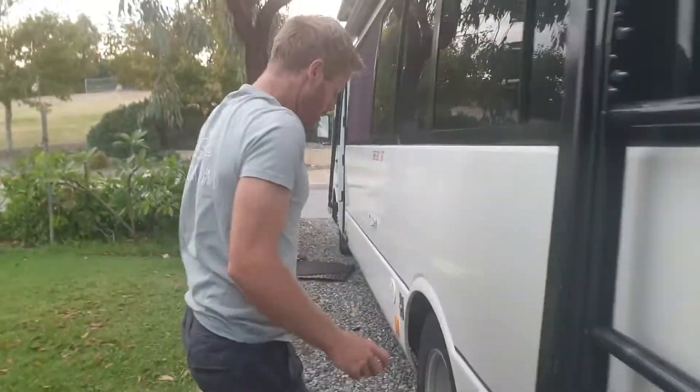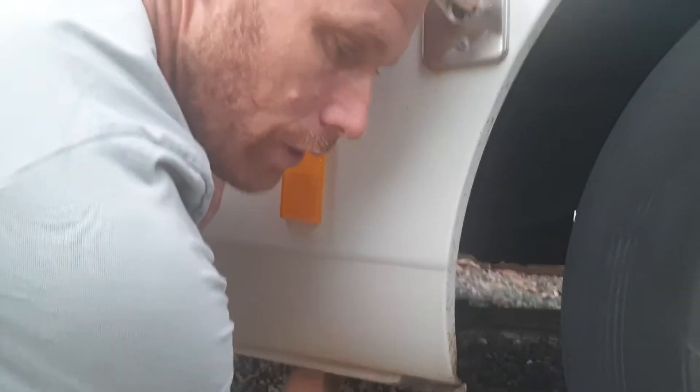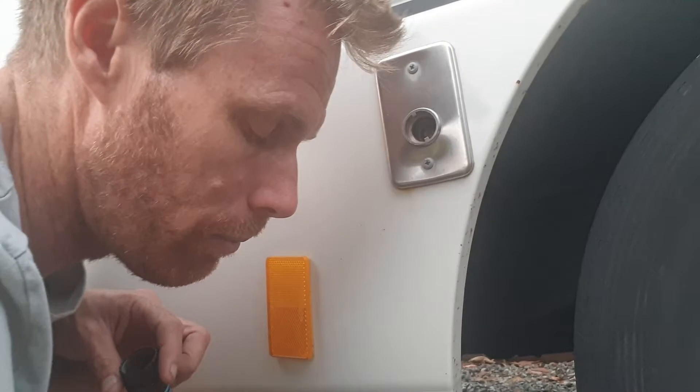I'll just show you the grey water. That black hose at the back connects to the grey water tank under here — it's just a loose push-on fit. You turn the valve and your grey water will go through the hose into your dump point or grey water drain.